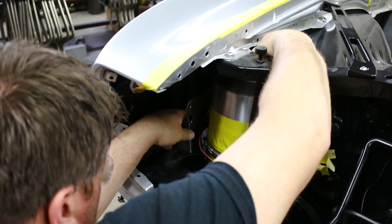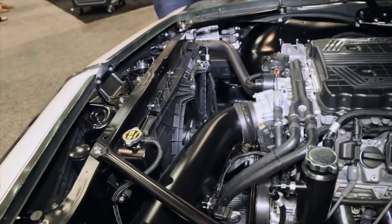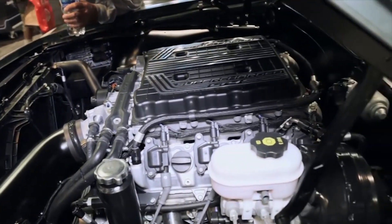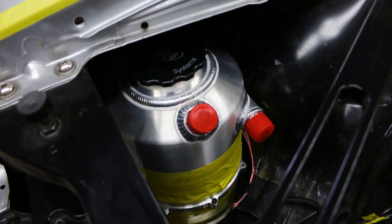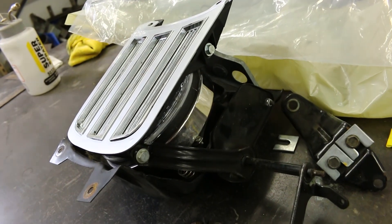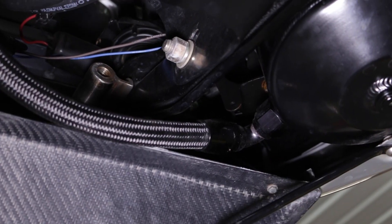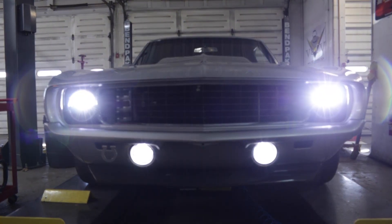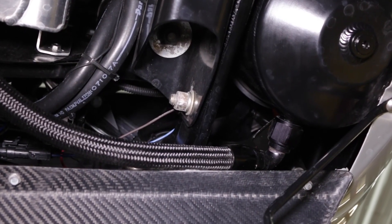The next challenge was mounting the dry sump oil reservoir tank. We had seen other Camaros with dry sump lubrication systems, and most installed the tank right behind the headlight — a logical decision, except this Camaro wears an RS-style nose with hidden headlights, and the motorized door requires additional real estate in the front fender. The headlight door actuating mechanism had to be redesigned: I removed the Detroit Speed motor bracket, flipped the motor upside down, mounted it to the bottom side of the inner fender, and remade the rods and extensions to get the geometry correct for the headlight door to operate. In the end, the crew was able to package the tank, plumbing, headlight motor, and other items into a tight space behind the fender.